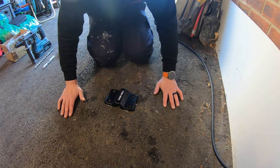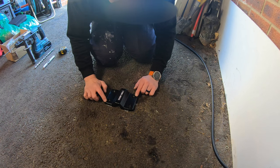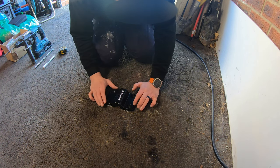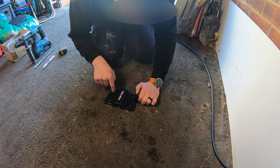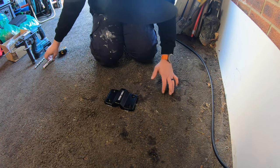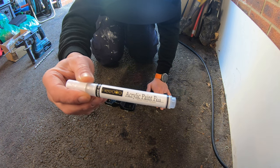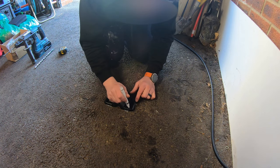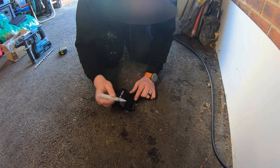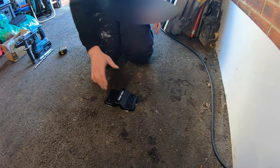Here's the asphalt floor. I've already marked it out, but I want to show where I put it because it's very important you have as little rocking as possible. If there's rocking and you tighten down one side, it'll try and pull up the other — each bolt fights against the other. You want them all to work together to go down. I use an acrylic pen; you can get a set of these on Amazon pretty cheaply. I dabbed the very centre of each hole — it'll wipe off easily with a bit of white spirits or a rough cloth.